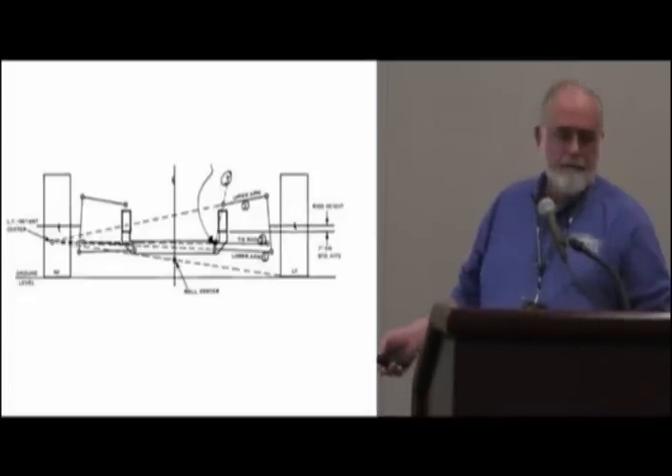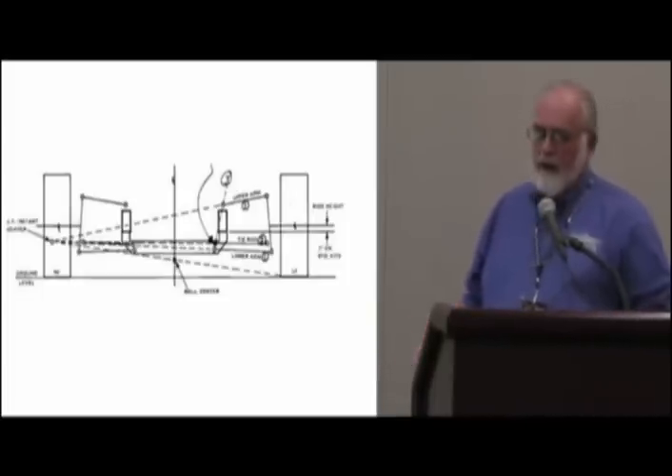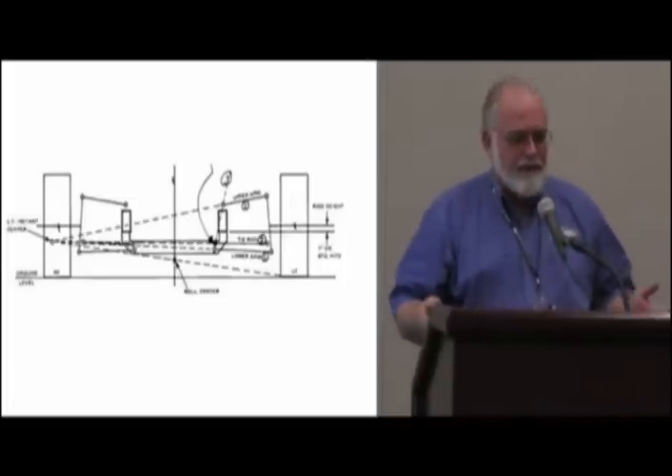You can see what it does to this geometry. What you've got here is kind of everybody in the band playing the same tune — they're all rotating about the same instant center. But if you start moving these angles and changing lengths and moving stuff up and down and pushing them all around, this is when you get into trouble. Now you're talking about jazz — you've got four guys doing a solo at the same time.